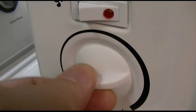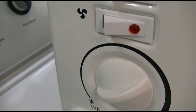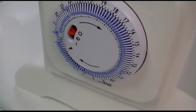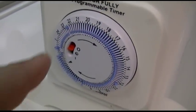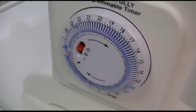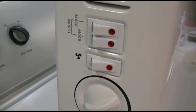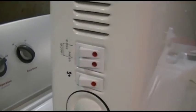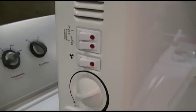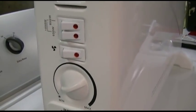This also has a mechanical thermostat — you can hear the click. But it has one other interesting feature: it has a built-in electric motor driven mechanical 24-hour timer. You can adjust all of these little petals — each one is 15 minutes for the entire day. That way it'll only be active at certain times of the day, and you can keep the switches off so you can't accidentally leave it on past a certain hour. Kind of nice if you have this mounted on a wall in an area that doesn't receive good heat, and you need to keep it warm in a colder climate or even in the desert when it gets colder at night.